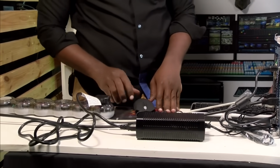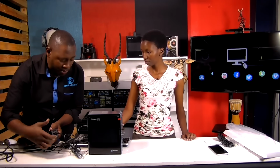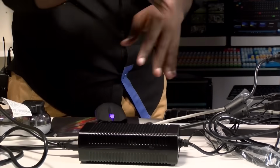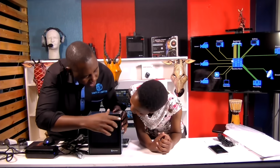And again, you need a UPS to protect the power adapter. So our source power has to come from the UPS before you insert to this. And power it up. When you power it up, you'll notice a power indicator on the adapter. It comes on blue, which shows that power has got in, and DC has come out of the power adapter to your unit. That's an assurance that power has got in.